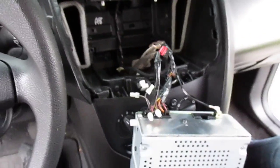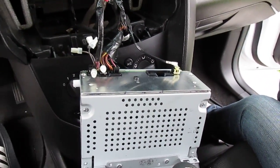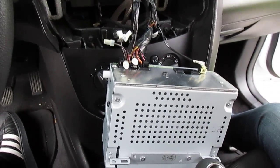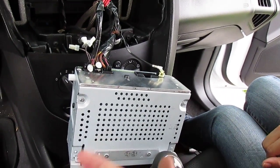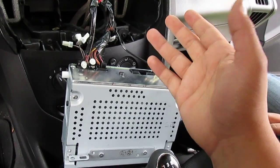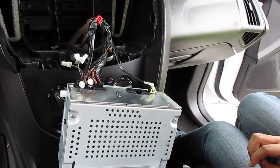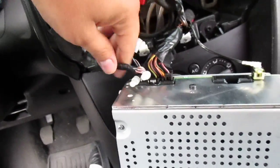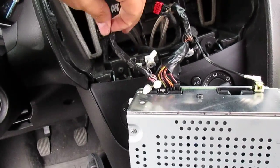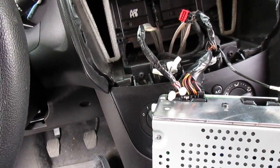If you buy an LC6, I believe it's an LC2i, that one you're gonna run in front and rear. But for me, I don't mess with my fader a lot, so losing the fader ability doesn't matter. I use the power gains on the amp as a fader. So anyways, you're gonna run these four. I don't have the positive and negative on me right now, but I will have it in the description below. So if you want to know what to wire where, look in the link description below. I'll have it all written out.